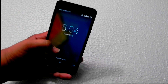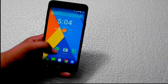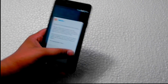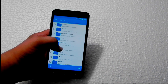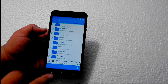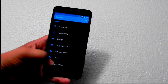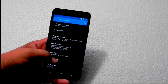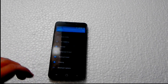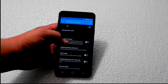I have downloaded the file from the computer and transferred it into internal memory. Internal memory is a bit faster than SD card. We will be going into the advanced developer options, which we can switch on with this build number — after tapping it 10 or 11 times we can get into the developer options. In developer options we will switch on the advanced reboot.